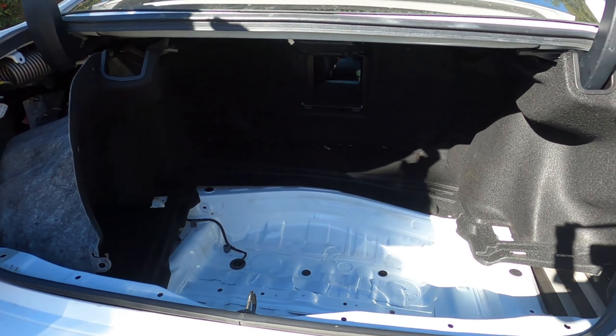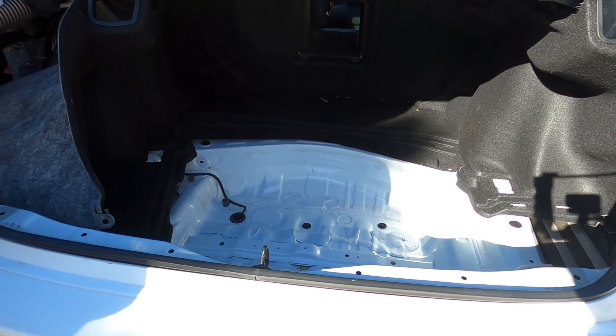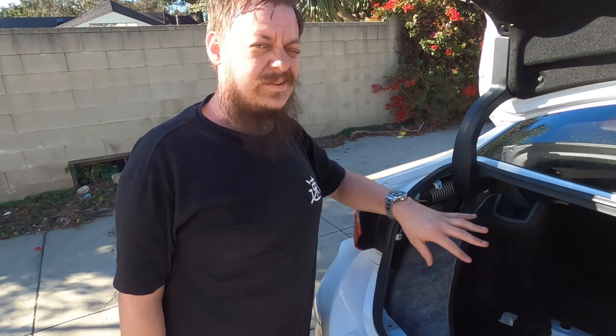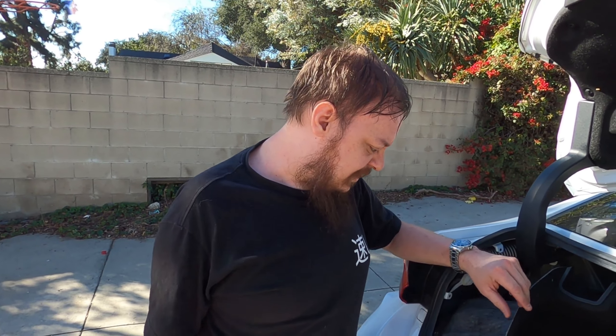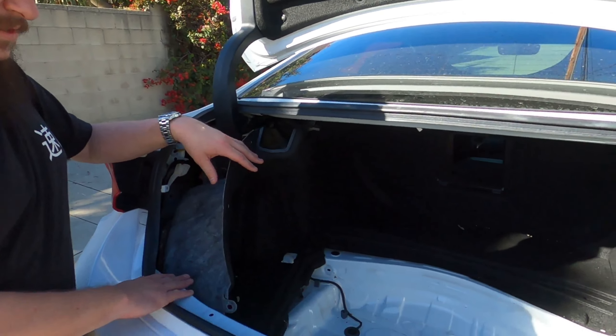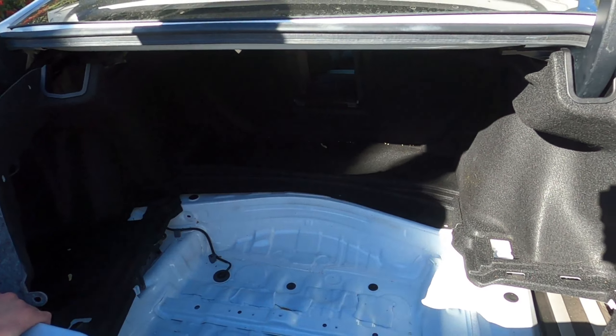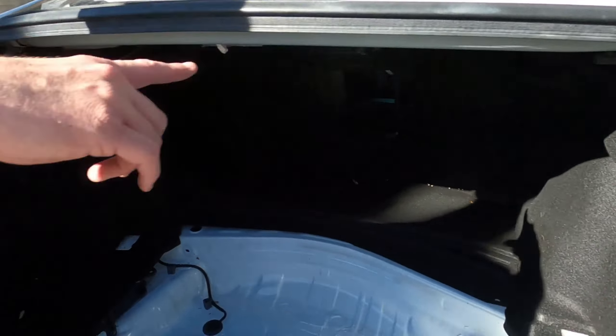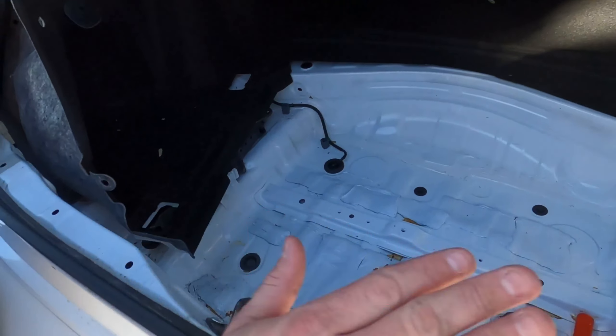This turned out to be more difficult than expected, but that seems to be a recurring theme with Lexus — it's an expensive car put together very nicely. There are roughly 27–30 clips to remove these panels. There's one, two, three clips and then you pry it up. You take the floor out, the foam out, the clips out of the top piece — about eight of those — then there are 10mm bolts that hold the luggage tie-down anchors.